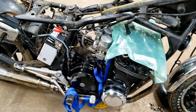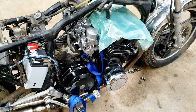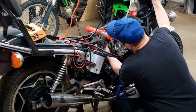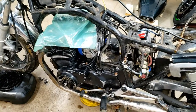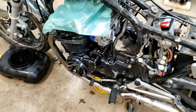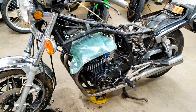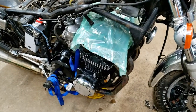First things first, I just immediately tried to see if I could get it running. The engine wasn't seized, surprisingly — just rolling it to my truck to bring it home, I could get it to spin the engine over by putting it in gear. I didn't have an adapter for my compression tester, so I just immediately tried to start it, and I eventually got it to fire up. You could tell from the sound it didn't really sound the greatest. Even when it was spinning over with the starter you could tell something was up — it didn't sound like it had even compression across all four cylinders. So I borrowed my buddy's compression tester adapter, and he also had a leak down tester, so I grabbed that as well. That really told me what was going on: I had about 25 pounds of compression in cylinders 3 and 4. I had a feeling it was leaking out the exhaust valves, and I was right.